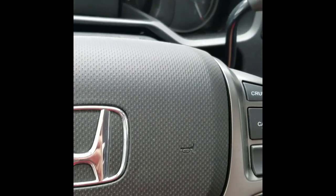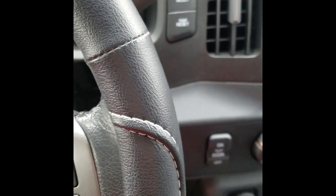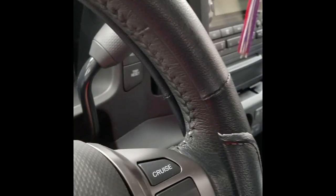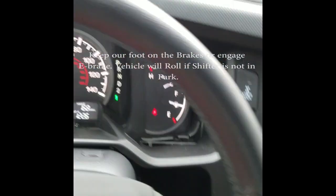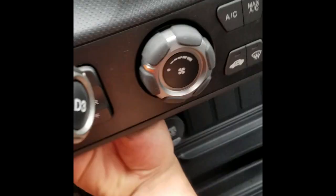Oh, there's a crack right there — how did I not notice that? Let me see if I can work around this without moving the shifter. There are connectors all over the place. Putting your key into ignition position two allows you to move the shifter down and gives you more clearance back here to unplug those harnesses. There's one more right here for the cabin light.